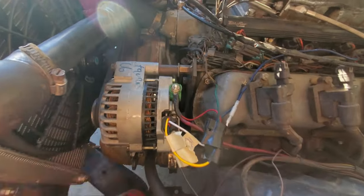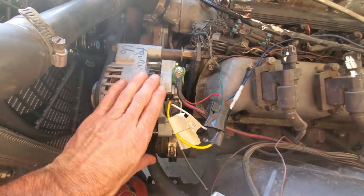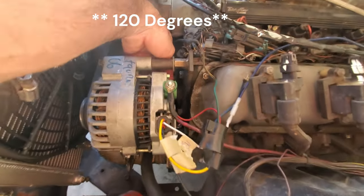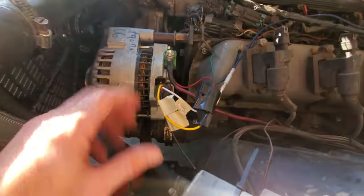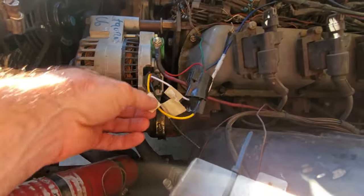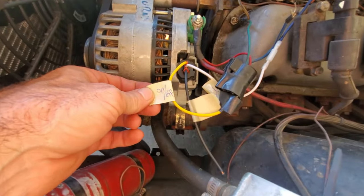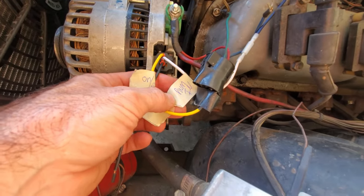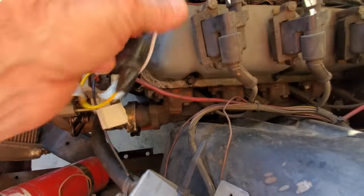You have your power wire that goes into the green deal. I also clocked the back of the alternator around — actually 60 degrees. This used to point down over there somewhere. So I was able to clock that around and put a new voltage regulator in there. I have these labeled: this yellow wire is the on/off, and the white wire is PWM-in — this comes in from the Megasquirt box.